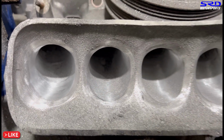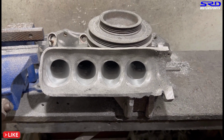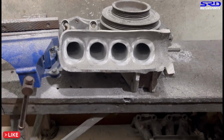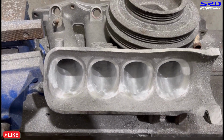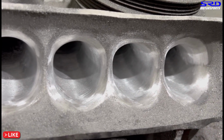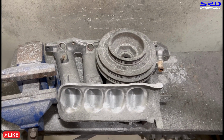It's because we spray it with some ethyl alcohol and soapy water mix, and we're gonna talk about that a little later. So yep, we'll make a few more passes here. As you can see, now it's a lot cleaner, but this is still 80 grit. It just changes how it looks. The more passes you make on the 80 grit, the smoother it gets, the more consistent.